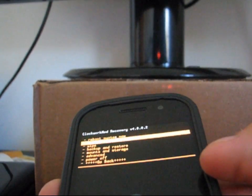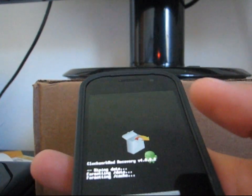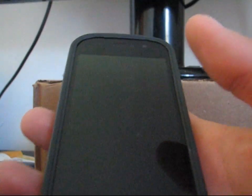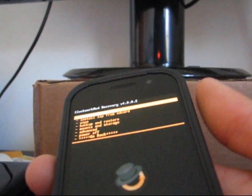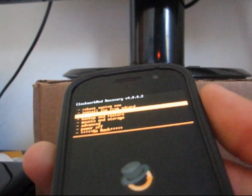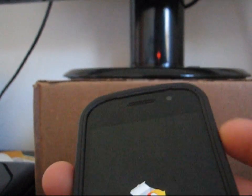Hit go back, and now you're going to need to go to Wipe and hit Wipe Data / Factory Reset. Select it, hit yes — Delete All User Data. It's going to delete all your data, so obviously your Android backup will back it up. You're probably not going to want to run this ROM as a daily driver just because of the issues. Then go to Wipe again and hit Wipe Cache Partition, hit yes — Wipe Cache Partition.